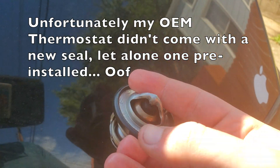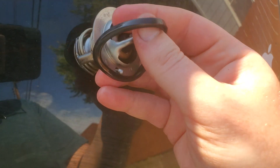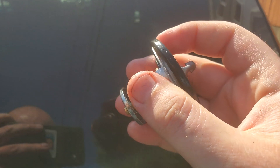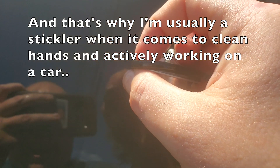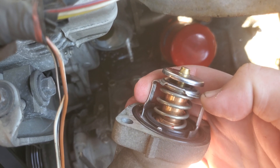You'll have to get another seal, but personally this seal looks good so I'm just going to reuse it. What you're going to do is peel off the seal — start it off by hand, start back here, then carefully take your thumb or fingernail, squeeze it down, remove it. It's separated. You'll pretty much put the seal back on the new thermostat the same way. Keep in mind there is a groove in the gasket in the back that sits in with this line here — it'll sit in nice and snug. Take your fingers and wiggle it on in there. Now that the jiggle valve is pretty much in line with this little provision here, keep in mind it can be installed within five degrees to the left or five degrees to the right.